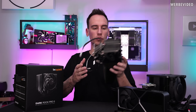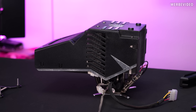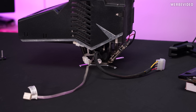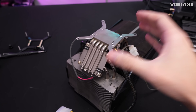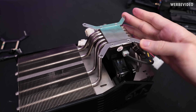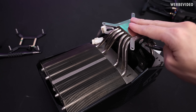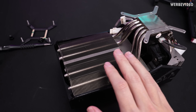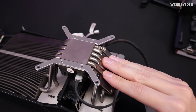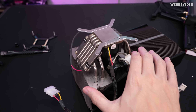Now we switch to the V10 to see how it keeps up. The CoolerMaster V10 is surprisingly similar in layout to the BeQuiet cooler — in the center you have something like an ordinary air cooler, and on the right there's an additional air cooler bolted to it. The main reason it looks odd is the TEC module on the bottom right. I had to adapt the mounting since the original was for socket 775 or 1366, so I milled some extra mounting pieces to fit a modern 1700 socket motherboard. There's a huge amount of heat pipes exiting the cold plate, going to a large heatsink surface with a fan blowing down from the top. The same heat pipes also exit on the other side to the TEC module, which is powered by a 4-pin Molex and rated at 70W.